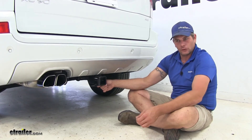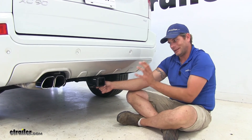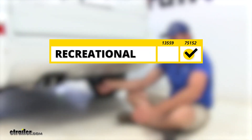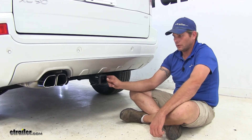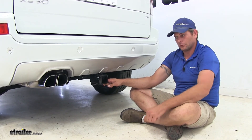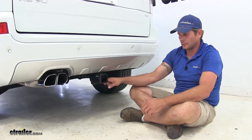For recreational uses — bike racks, cargo carriers, or any class 3 accessory — the Draw-Tite is the better choice because of its higher tongue weight rating, which eliminates some flex. Although if you're using a cargo carrier or bike rack with a very short shank, the inch and three quarters that the pinhole moves back with the Curt can be a slight advantage. But for four or five bike racks or larger cargo carriers, the Draw-Tite is definitely the way to go.